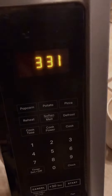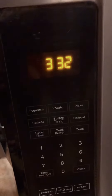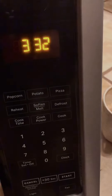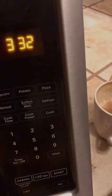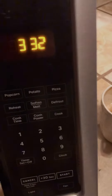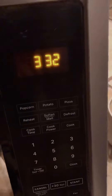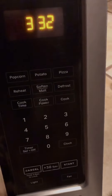Pressing number four will give you a reading. Based on room temperature it will be a different reading, so keep that in mind — this is testing the HF NTC thermistor. You're going to get a reading between 100 to 977 depending on room temperature.